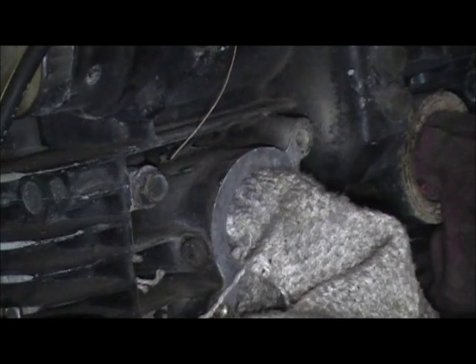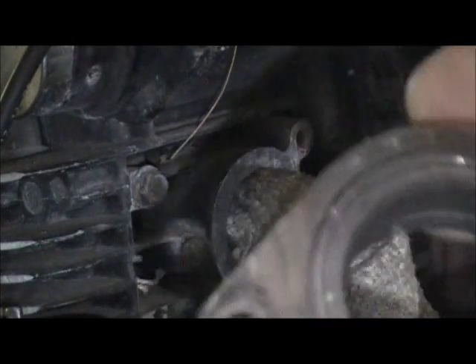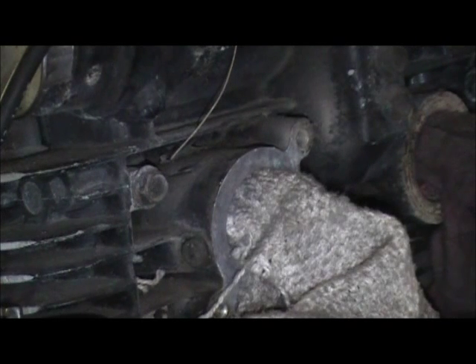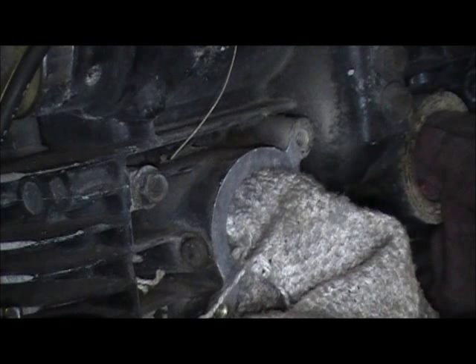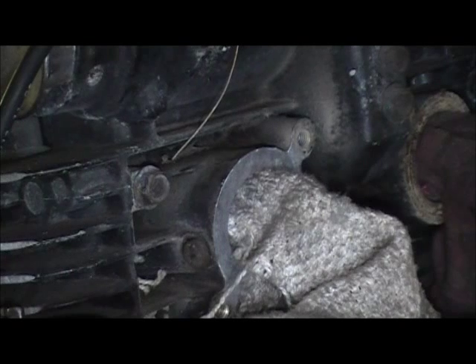I'm going to pull that gasket out of there before I clean it up — just make sure they're clean. We're already this far in the damn video. When you go to put these on, use this right here: Indian Head gasket shellac. Don't use that fucking Yamabond and don't use that fucking high-temperature Felpro. That shit's lost a lot of people a lot of races and I've got a wall of license plates to prove it. Anyway, that's how you do that.